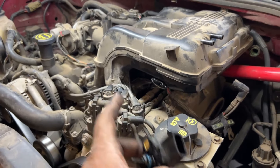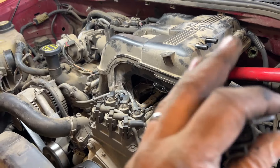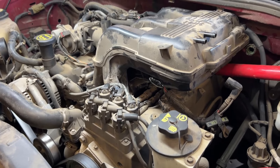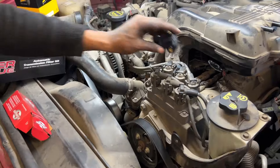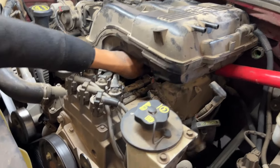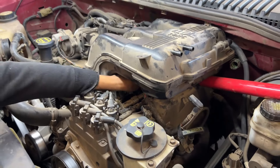So now we can slide the other one back in. Much, much easier. Now, if you suspect a vacuum leak or hear a vacuum leak under this plenum, do not do it this way because you're going to have to replace that gasket. So now we're just going to do it backwards — we'll take the new one, poke it in, start with the vacuum hose putting that on first, and then run those two T27s down and everything backwards.